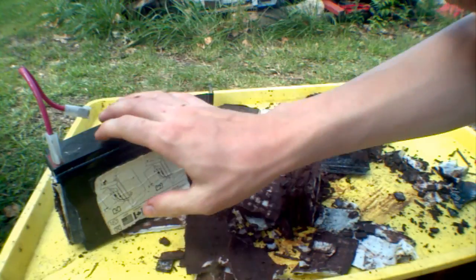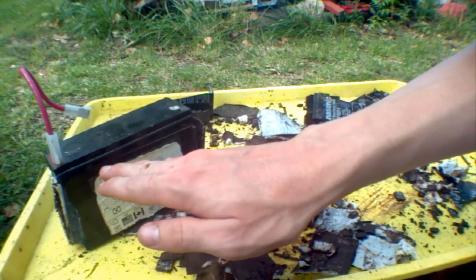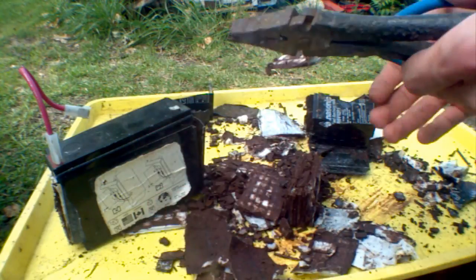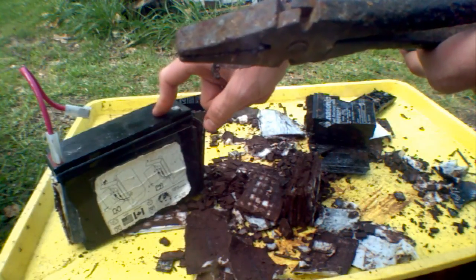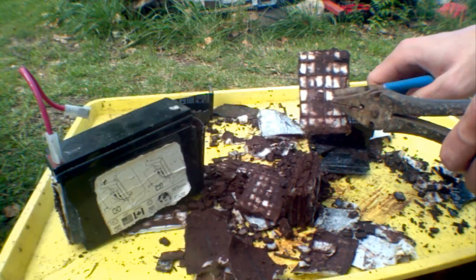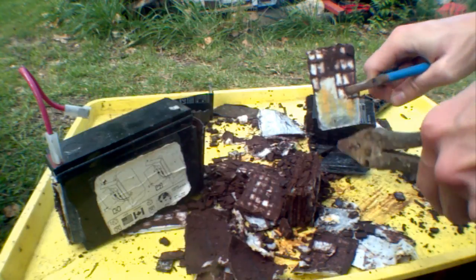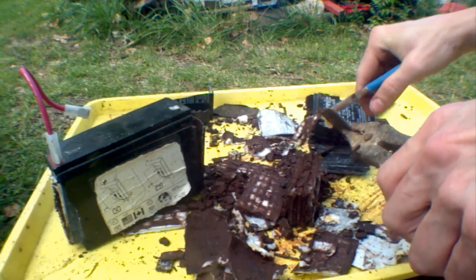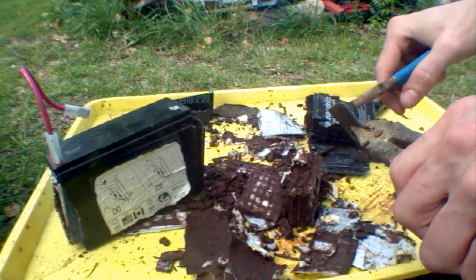Like in a regular truck battery — let's imagine this is a regular truck battery — it would be filled up and there would be acid sloshing around in there, well, if you shook it. But in a battery like this, the whole appeal is that you could turn them upside down and it wouldn't leak out, because they have a spongy material that is soaked with the acid. Since the acid is soaked into it, if you turn it upside down, the acid doesn't come out. I imagine if you squeezed it, though, it probably would.